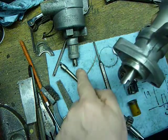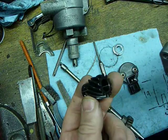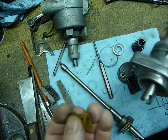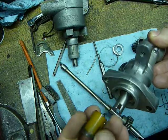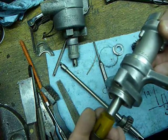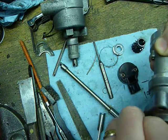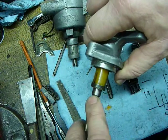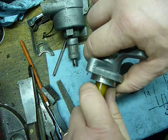This shaft is slightly larger than the 280Z shaft, and I didn't really want to stick this back on there because you really don't need it — it's just extra weight. I have a lathe, and I turned this shaft down to the same diameter as that shaft, and I've marked it. I still need to drill it for the pin, but this will slide on like this, and then the shaft will slide in. It's basically retained by the spring clip, and it helps center it and keep it from flopping around.